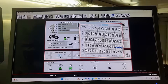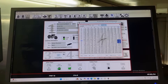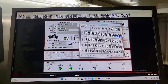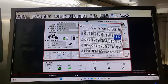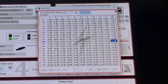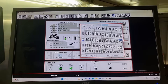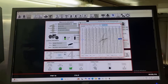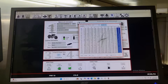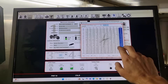Let's take a look at the timing — just the rear. It's got 30 degrees in it, they're obviously looking for power. You can see the 27 degrees there, so someone's done this with an idea of what they're doing. There's probably not enough timing here to start with — probably want a little bit more there. It does step up pretty well. There's a big jump there — from 18 degrees to 27 degrees, that's a 9-degree kick in the spark curve. That's huge, it shouldn't be that big.